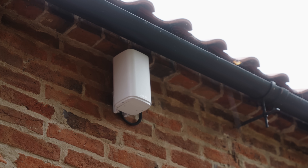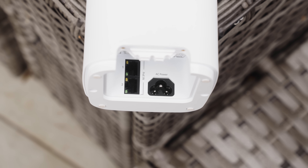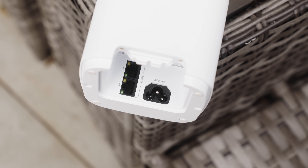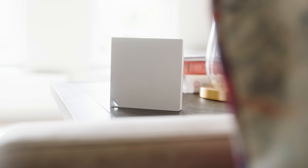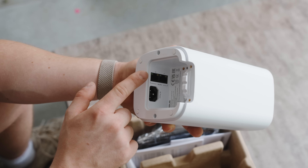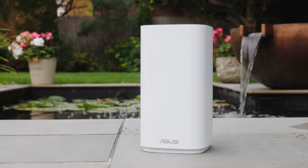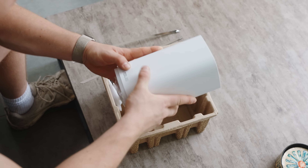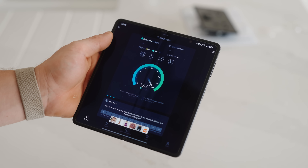As far as the Zen Wi-Fi outdoor unit specifically is concerned, I'm really impressed. Multiple power methods with the clover port and added PoE with two-and-a-half gig ports — and you've got two of them. You can set the device up as an AI mesh node repeating Wi-Fi from an existing ASUS system and bridging a building together like we did today, or set it up as a router using one port for WAN and the other for LAN, or use it as a wired access point powered via PoE. Overall I'm really impressed with the speeds — we managed to link my grandma's house to my dad's house today. I'll put all the links to the products in the description.